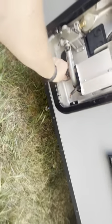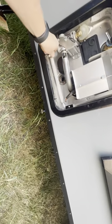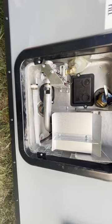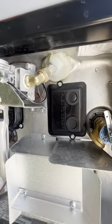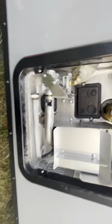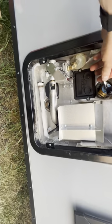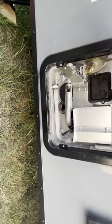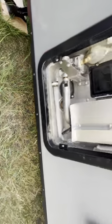You'll fire it up once it's filled with water — there's a spot in the bathroom I'll show you where that is. If for some reason it doesn't fire up right away, there are reset buttons here. When you go to drain the hot water and you're done camping, you want to release the pressure here first before removing the plug.